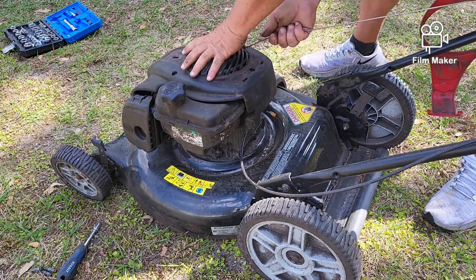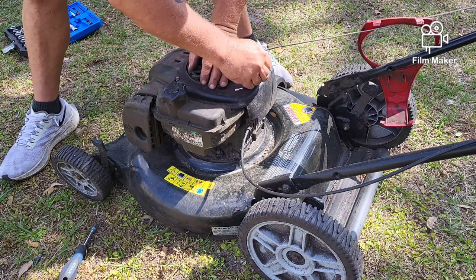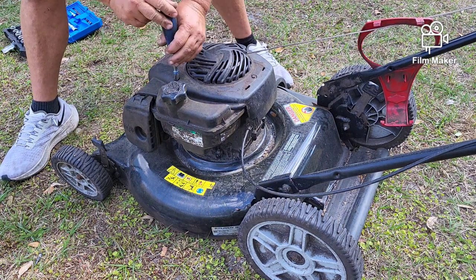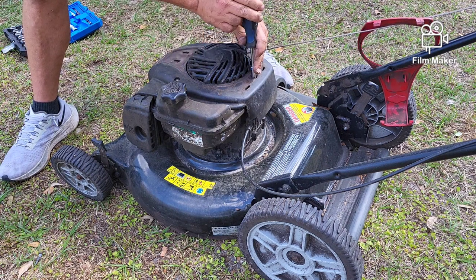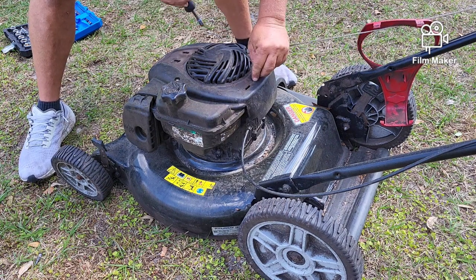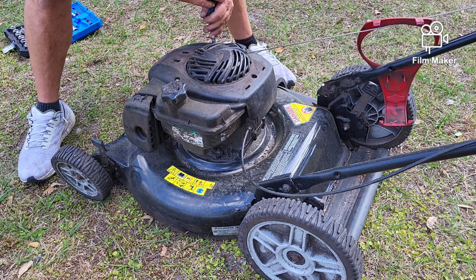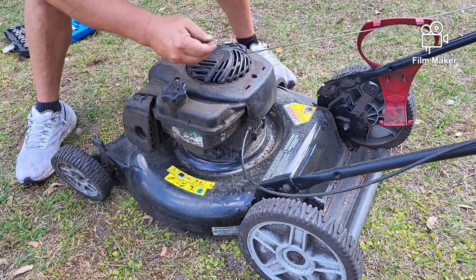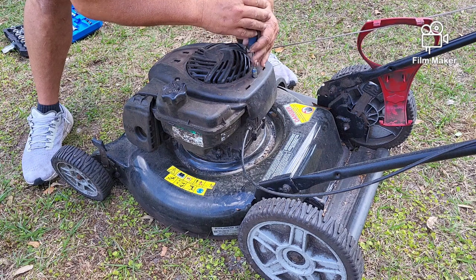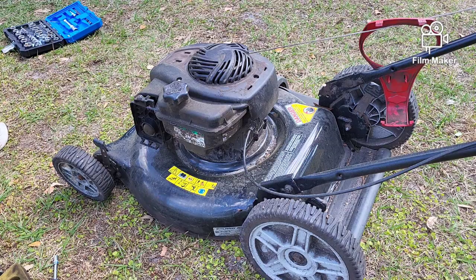So I'm going to stick this back on, because the next thing we're going to do — and if you watch my channel, you already know — leave in the comments what I'm going to do next. I am not the one that checks for compression and spark and wastes my time when repairing machines. You can't charge much for lawnmowers and I'm doing this for free for the kid, so you have to do things efficiently. Why waste time getting out my compression tester and spark tester when I can literally test for compression and spark all at the same time? I'm going to spray a little bit of carb spray in there and see if she'll bark, and then we'll know what's going on.